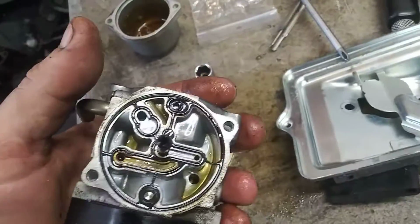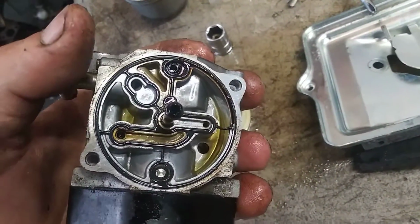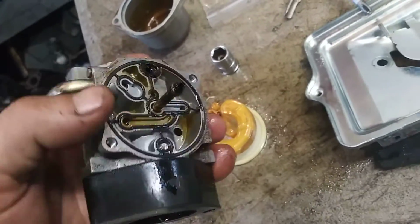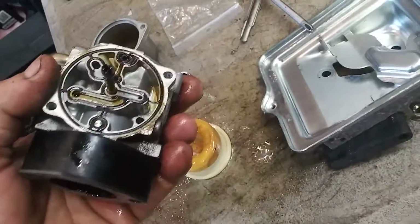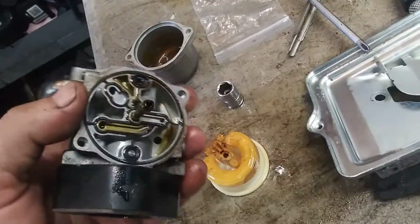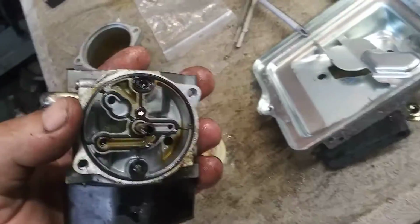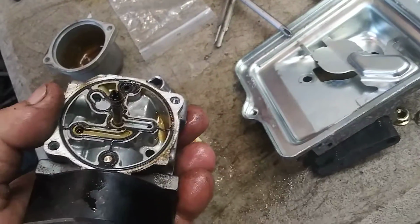Now all this is going to have to be cleaned, but this seal, as soon as carburetor cleaner hits it, will swell up. I'll have the kit for rebuilding it in the description. I'll have a brand new carburetor where you don't even have to mess with this. Super way easier just to put a brand new carburetor. I actually have new carburetors, but I want to show you guys how to do this in case you don't have one laying around or something.